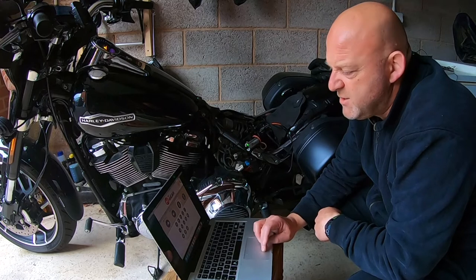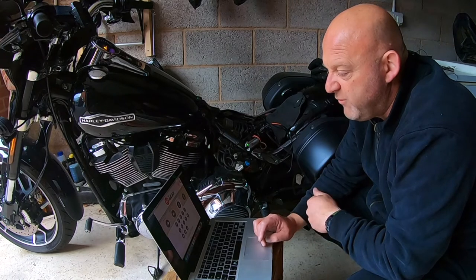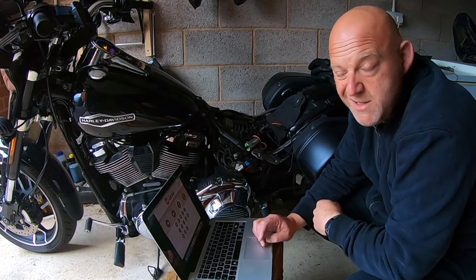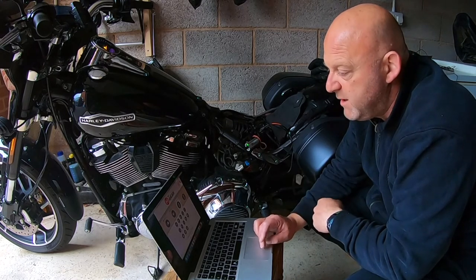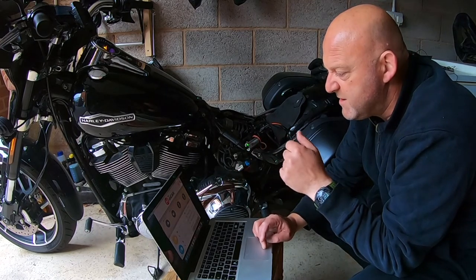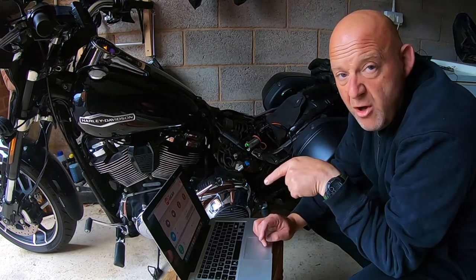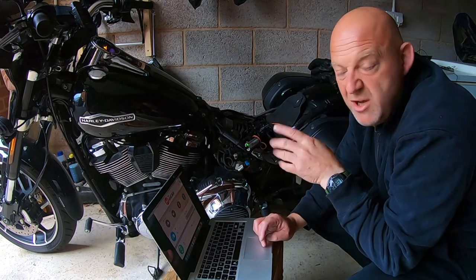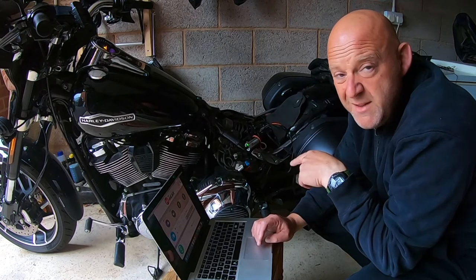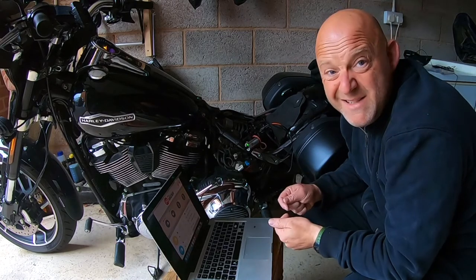Basically, with an accessory, it gives me 10 amp continuous or 25 amp maximum for 25 seconds, and 25 amp continuous draw for the entire system. So that's the Hex ezCan there. So apply that. I don't want it to be active with any lights or anything like that. It's just accessory power. Actually, I'm not going to have a timeout of 10 seconds. I'm just going to turn this off, so as soon as I turn off the ignition, the power is cut to it. Right, that's all done. So let's test it now.